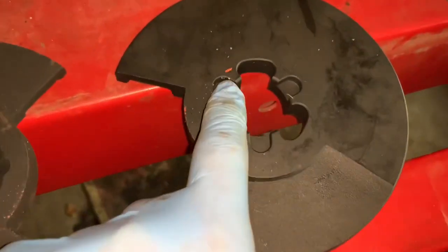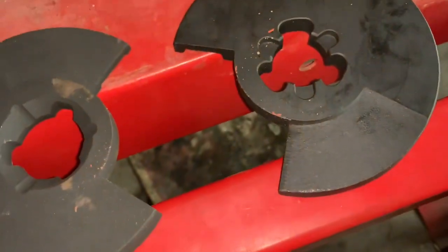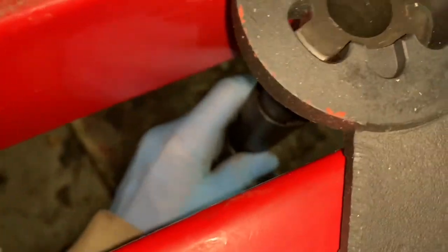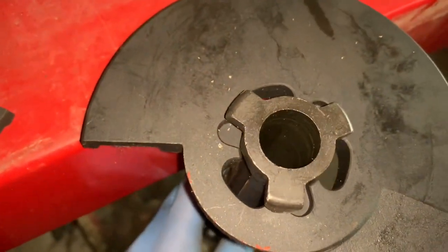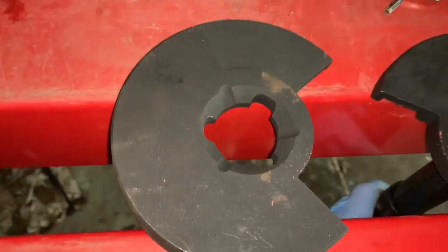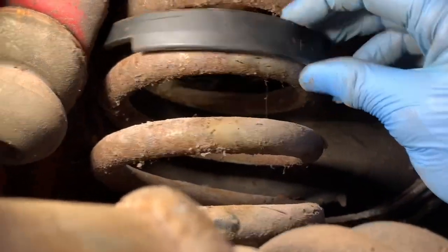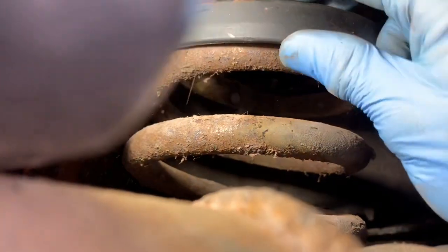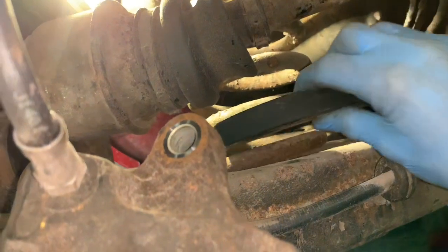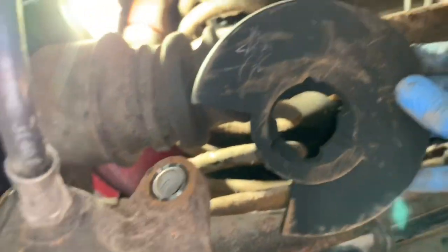The tops of the two plates are different. The one with the grooves in is going to be the top plate — it goes underneath and spins round to lock in. That is the bottom plate; it'll obviously be the other way around. Put the top plate in, but make sure you don't put it with the flat edge facing inward, because when you wind the spring up it's going to catch on there. You want the open end positioned so the spring extractor isn't near it. The bottom plate goes in at the bottom of the spring — make sure you get it the right way around.